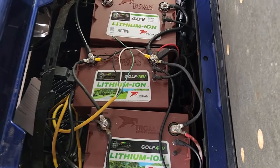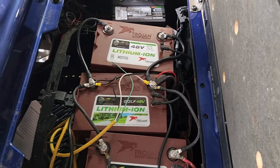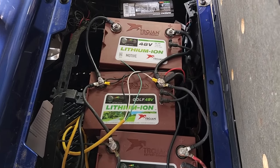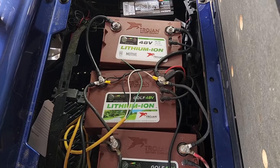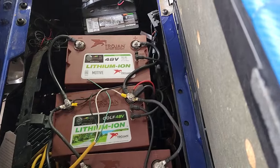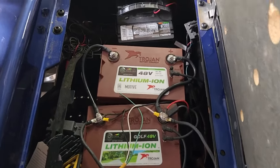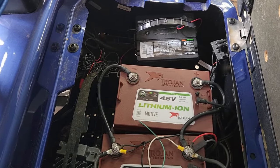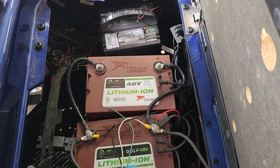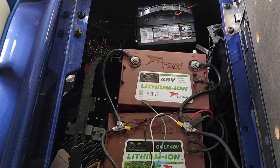The battery won't be 100% capacity but can likely be returned to the customer. Four years is the minimum time I've really seen a lead-acid battery fail — I've never seen a Trojan or Crown fail within four years, unless it was a NAPA, Duracell, or Interstate battery. Those cheaper brands sometimes fail at the four-year mark.